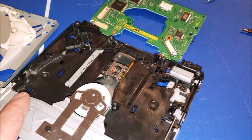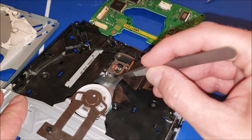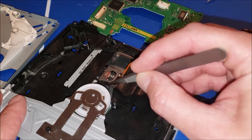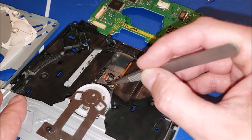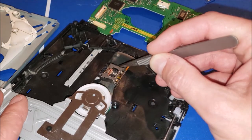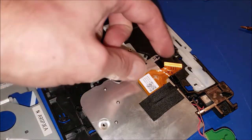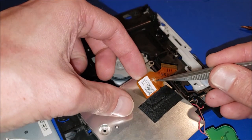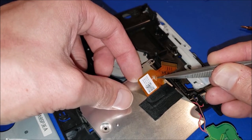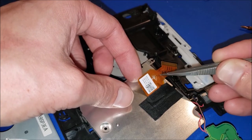We're inside the optical drive assembly on this one and there are a couple things I'm noticing. First, the motion of this is pretty stiff — it takes quite a bit of force to get that to move. I'm starting to think that's the main issue: something is binding this up and either the motor doesn't have enough force to get where it needs to go, or just fighting it so much is causing problems. The action on the slide is definitely rougher than on the previous one. Another thing I saw — maybe not an issue — is there seems to be some solder on this flex ribbon, but it doesn't appear to be bridging the conductors, so I don't think there is an electrical issue there.